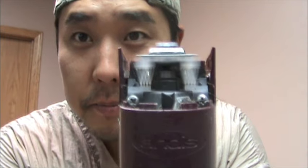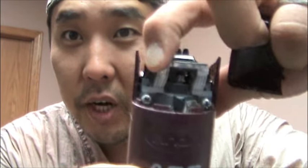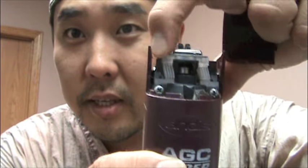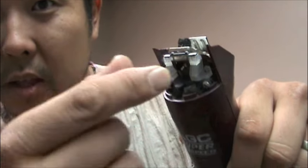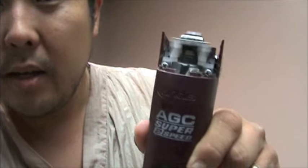This clipper runs on a blade drive — see that? This blade drive goes back and forth. I just replaced this recently — very easy to replace. You just take off these two screws, slide this out, put the new one in and put the two screws back in. The thing is, when you keep your blades clean and well oiled, it's not putting too much wear and tear on the clippers itself. You won't really have to change the blade drive out that often either, because it's not working as hard to keep moving dull, un-oiled blades.